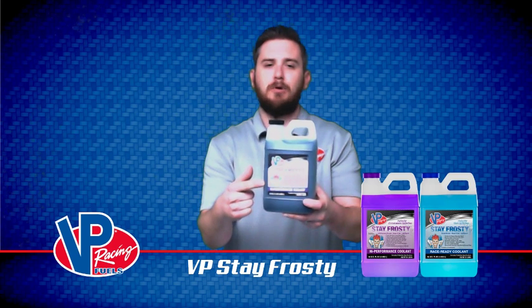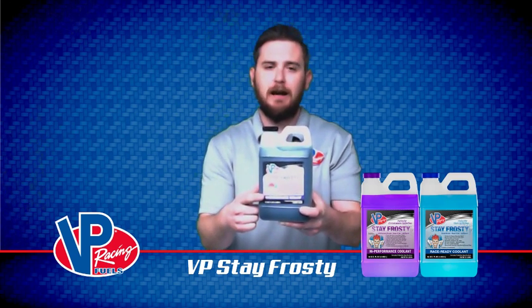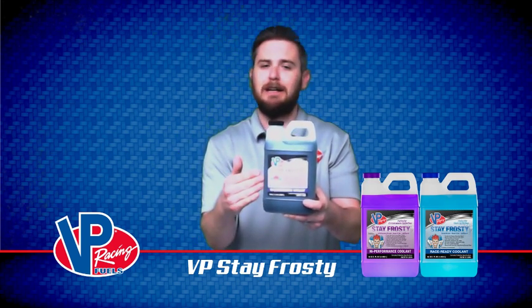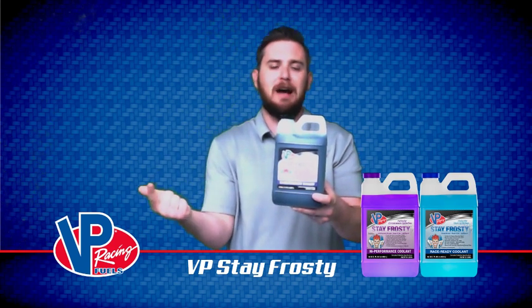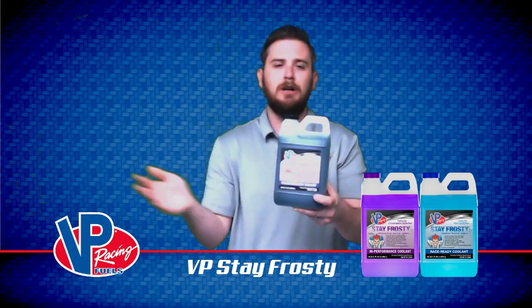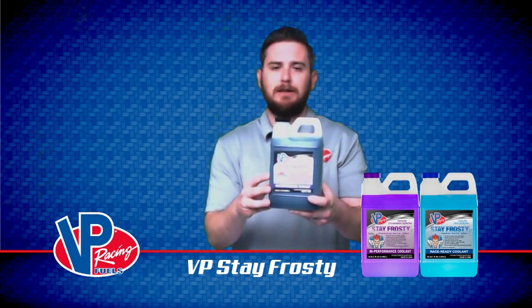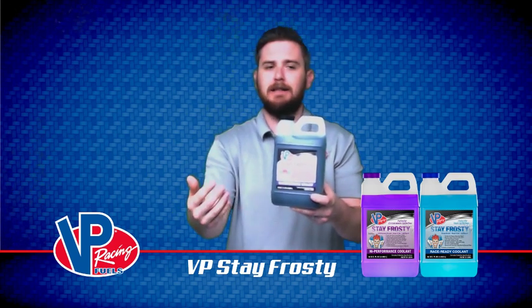You do have that propylene glycol as freeze protection. It's only down to 0 degrees Fahrenheit. So folks that just went through the polar vortex, don't use this specifically as an antifreeze, but it's got freeze protection in it. This is great for markets such as your hot rodders, your classic car audience. We've been taking these types of products to the Good Guys shows with us this year. We do a national circuit of car shows and hot rod shows and such. And this is very popular. Everyone is overheating at these types of shows.